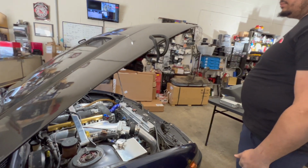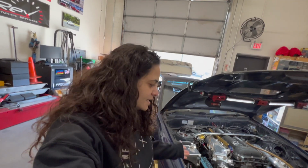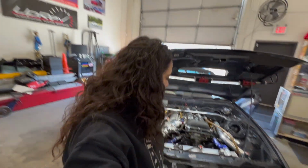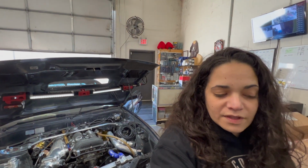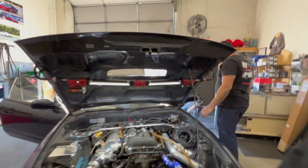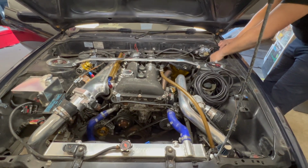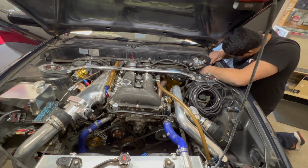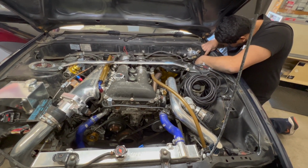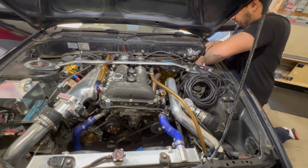So that's reason number 87 why you don't want to just throw parts at something. I had asked Edgar last night, why don't we just grab another harness? Maybe the harness is shorted somewhere. And he was like, well, you get a whole new harness and then you still have the same problem, which is a good point. So better to make sure that it's not the harness. And really, without a wiring diagram, that requires you to go bit by bit, wire by wire, connection by connection. Some stuff is similar, but other stuff is not.